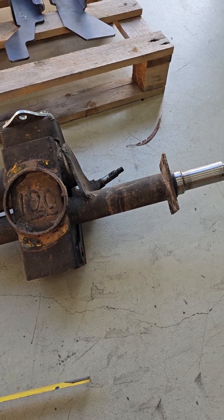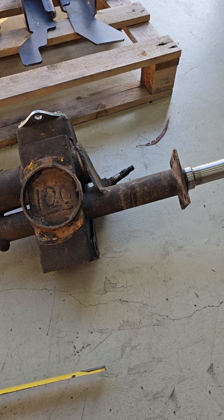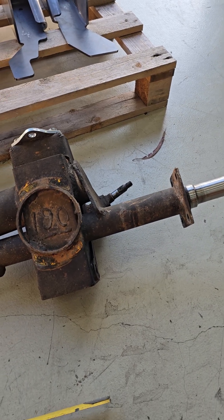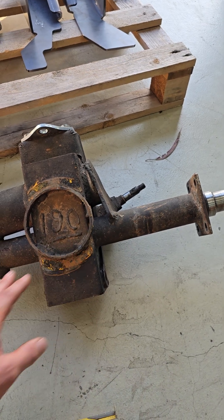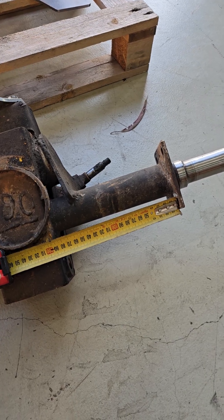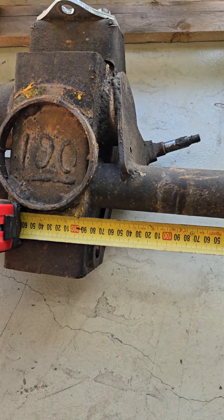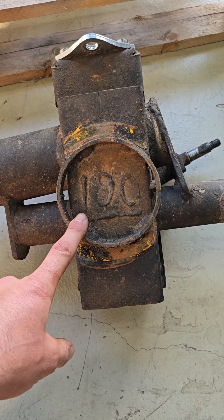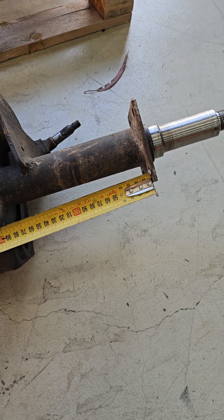This is a good clean asymmetric arm — it's just come out of a van. This customer's van is being upgraded to the two-tonne asymmetric arm. Offset is the distance at which the stub axle is installed in this component, which is the asymmetric arm. We use the measurement from the back of the backing plate mount to that vertical plane there, which Track often referred to as the carrier plate. It is often the case that the offset is actually recorded in millimetres in the lower spring seats — this one's 190 — and we measure that and that's what we get on the tape as well.